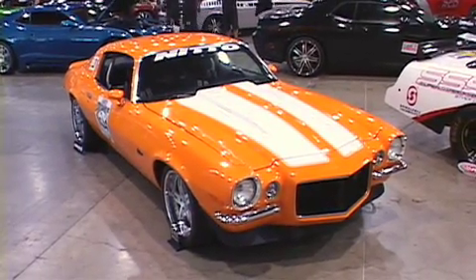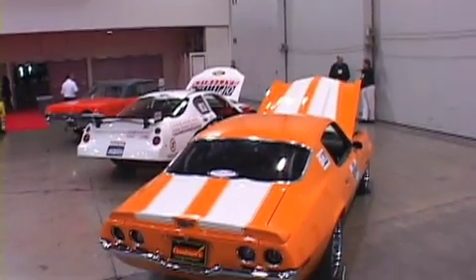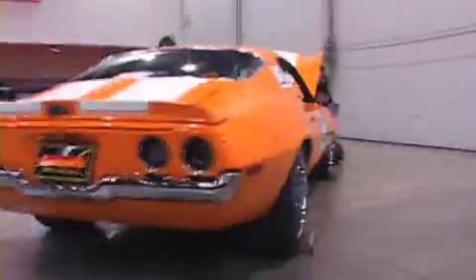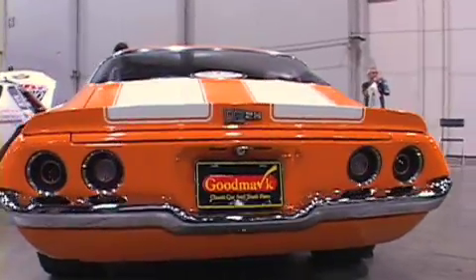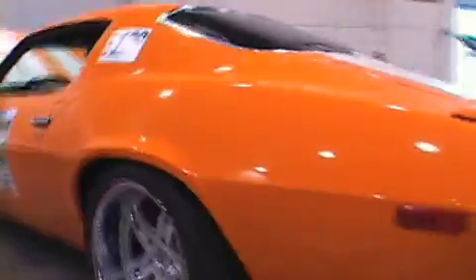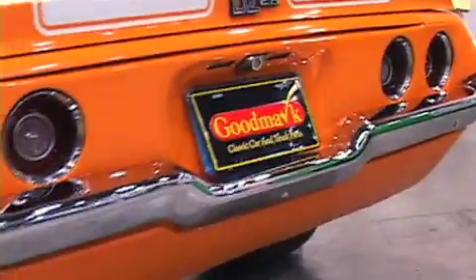What we have behind me is a 1970 Camaro. The car was originally built back in 1998 — it was my first magazine car for CarCraft Magazine. The car was originally tagged in the back end in an accident. We chose to go with a full quarter panel from Goodmark, which goes inside the door jamb and up to the factory seams like GM did it originally. We did that also with the rear taillight section.